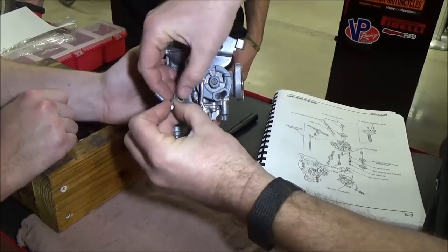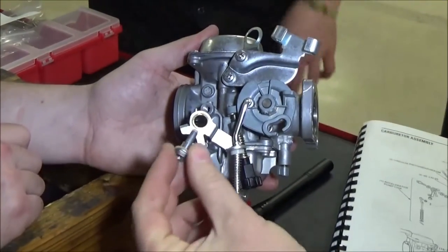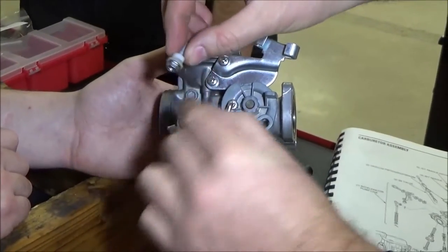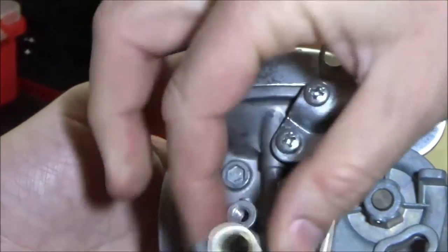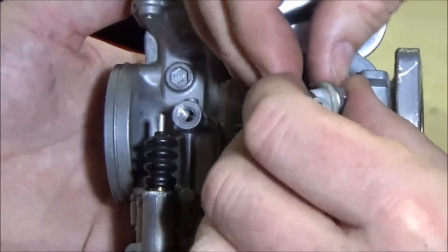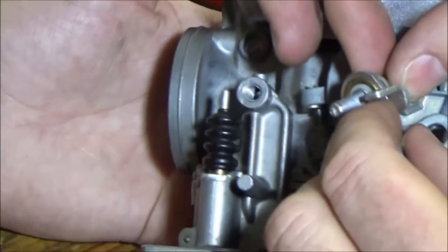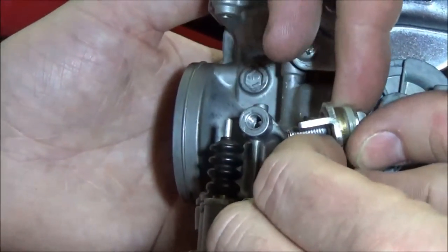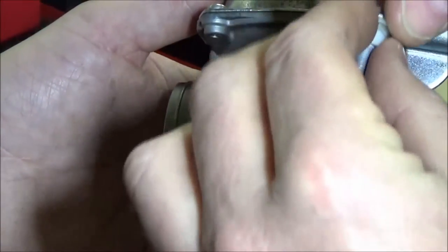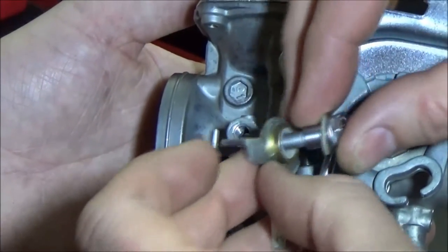Here's what people do wrong — if they put the washer on first and then put this on, do you see how it makes it too thick? Then there's not a washer on the other side. Now I'm not all the way through, and if I tighten that bolt down I'm going to make it lock up and the accelerator pump won't work at all. I'll have this all the way back on the bike and then I'm going to be hating it.